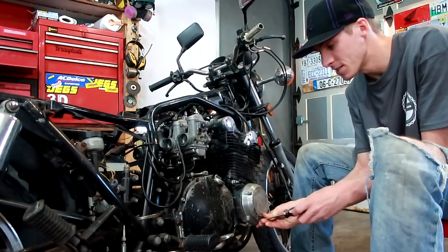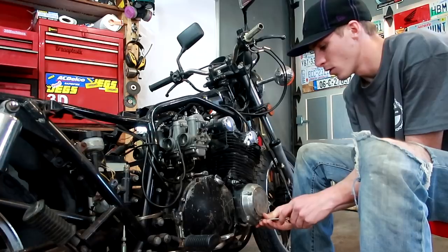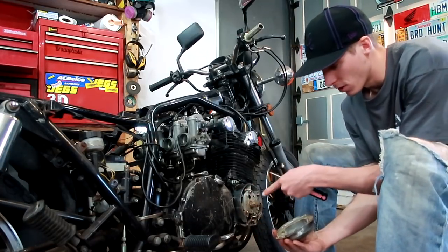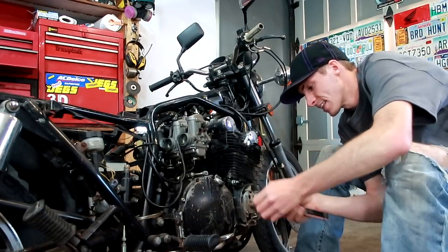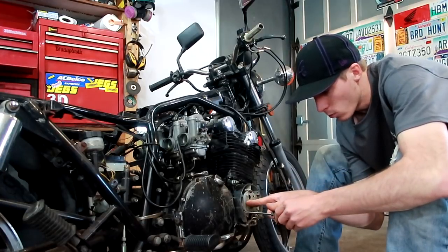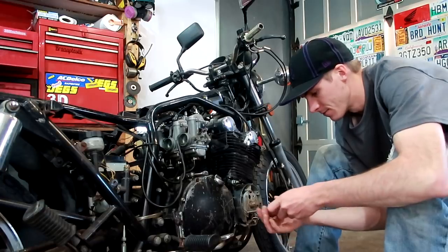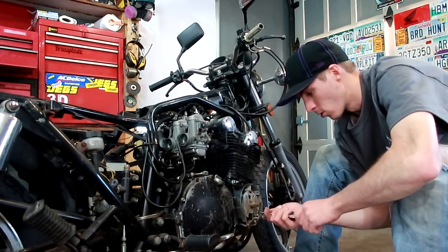This is where I'm going to have to do a little bit of explaining. As I'm sure you didn't miss, Jake the Toilet Snake came down. We tried to get this thing to get spark. The only problem was, after we removed this cover, we found out that this was all jerry-rigged. And it still is jerry-rigged. We tried to put points on this thing that I purchased, but after trying to put them on this plate, the left side worked. The right side, however, wouldn't clear the shaft here. That not happening, I had to buy a new set. There was no way we could go around that.